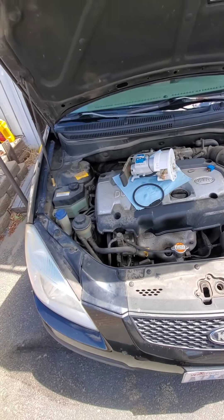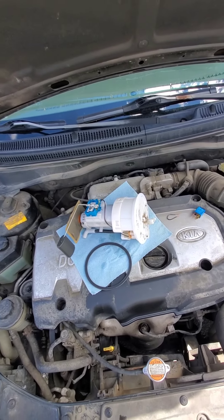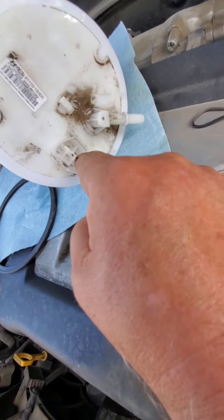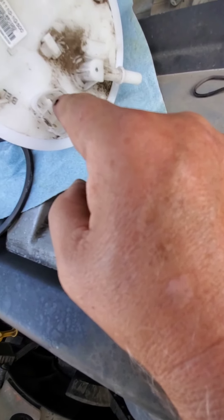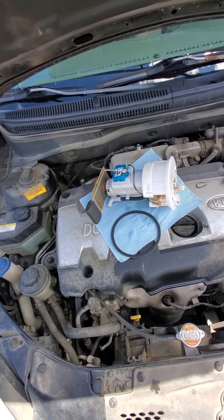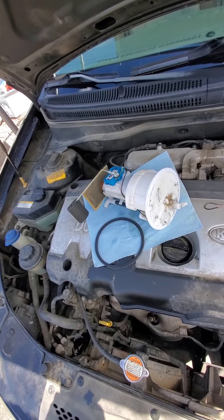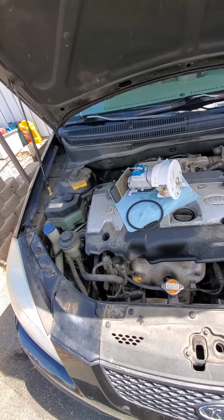I have mixed feelings because I think it's the fuel pump. I jumped positive and negative off the battery onto these two back connectors, and my test light lit up — so there's continuity — but the pump does not engage. That tells me the electric motor that pumps the fuel is bad. So I'm going to get a new one ordered and then install it.